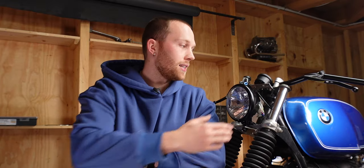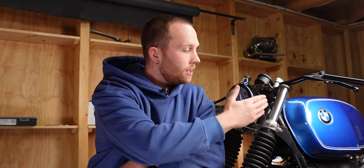There are multiple ways how you can actually lower your classic motorcycle forks. You could either machine the actual fork tube or you can go the easier and cheaper route — that's what we're gonna do — and make or buy a pair of spacers. From what I've seen that works for most conventional motorcycle forks, so I'm going to show you how to do it. But first we need to get the forks off the bike.